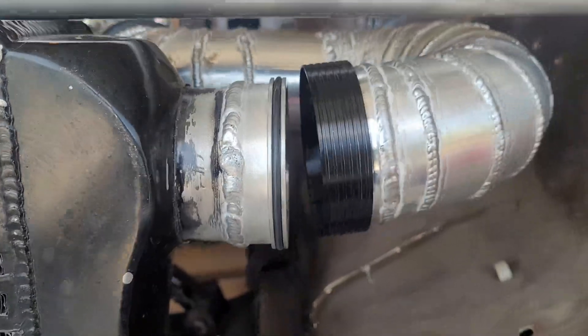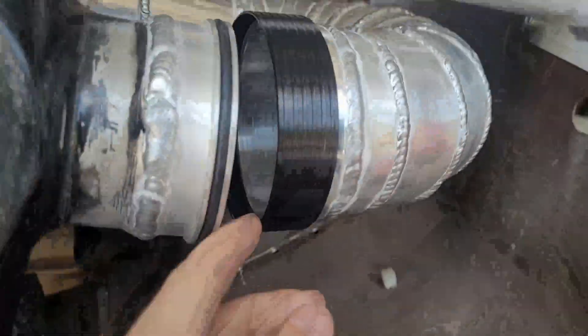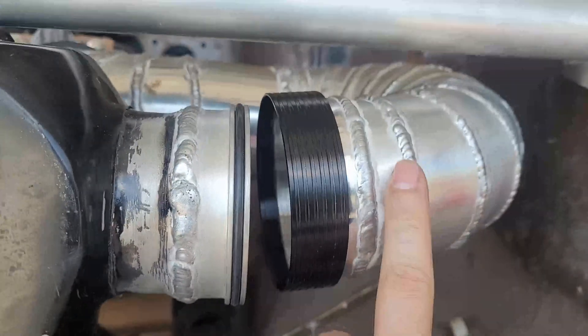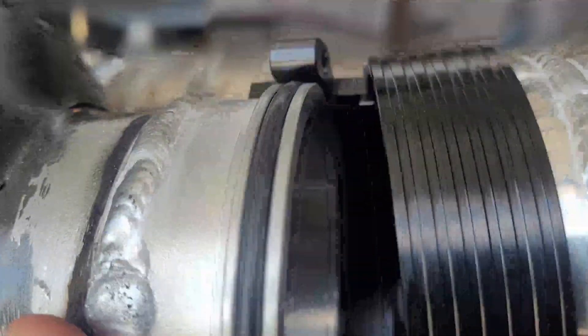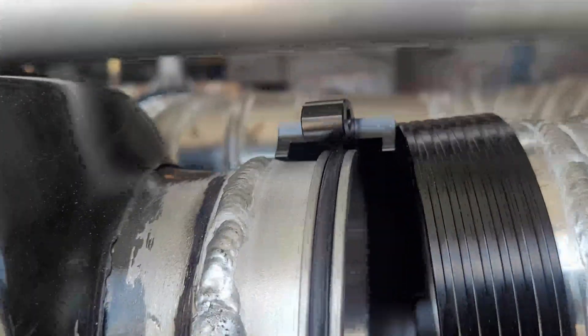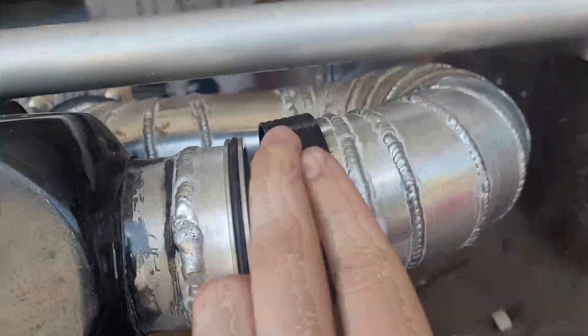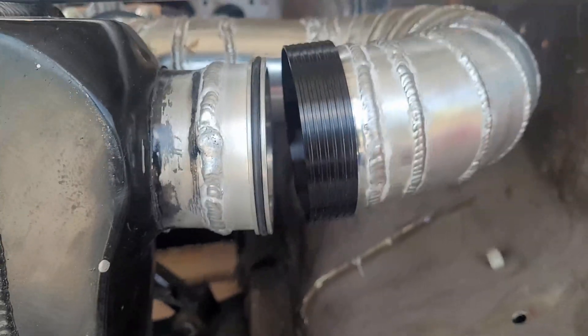Alright, we're back — it's about 90 degrees in Michigan right now, so if I look horribly sweaty, that's why. So these clamps: you have one fitting that gets welded to whatever you're trying to join, and they have an o-ring in here that seals the inside of this sleeve. There's another mirroring piece just like this welded to the other side, and these o-rings seal on this sleeve. Then this collar piece fits around and in between these clamps so that they can't blow apart.